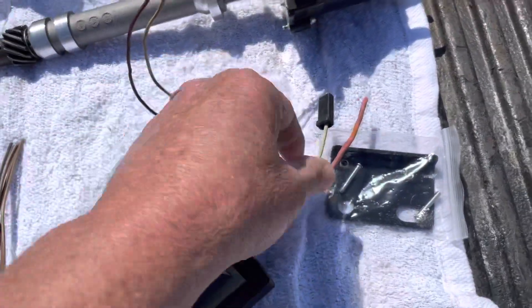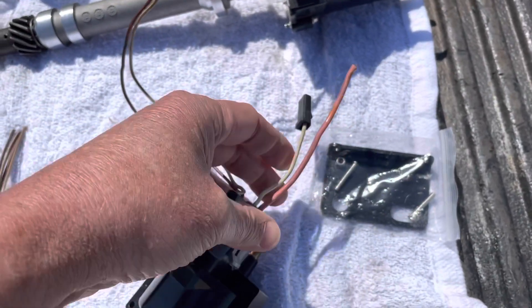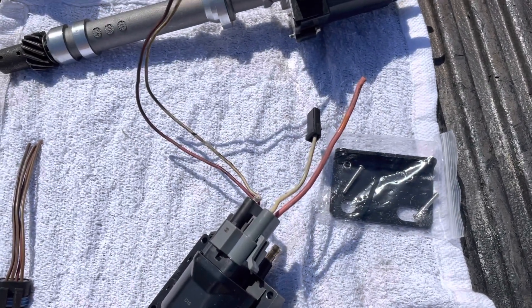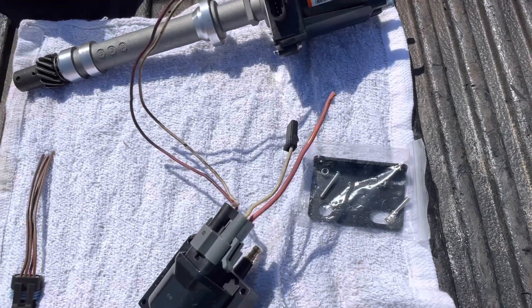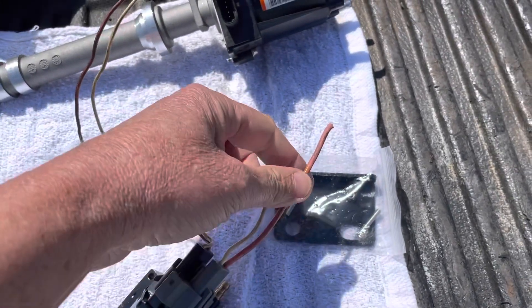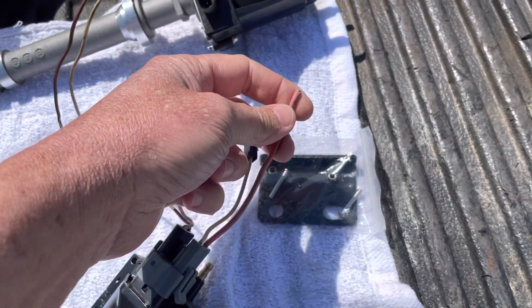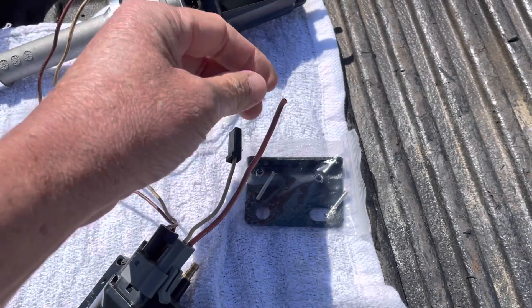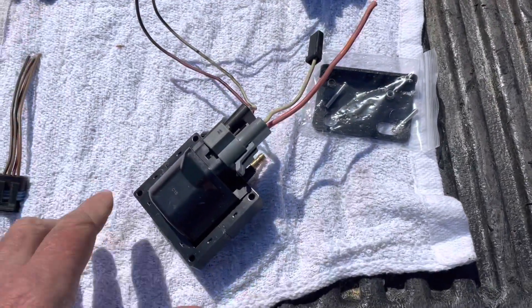When you put this coil in, your existing coil in your Thunderbolt system will have two wires going to the ignition coil — a positive and a negative. For the Mercruiser system, the positive is purple and the minus is gray. You'll want to take your purple wire going to your coil and splice it in using a bullet connector so you can unplug them later. Attach the purple wire to this pink wire here — that's what provides power to this coil.